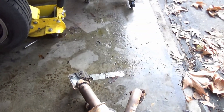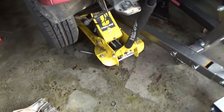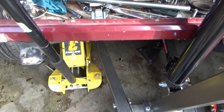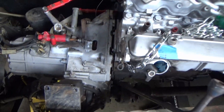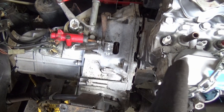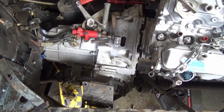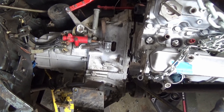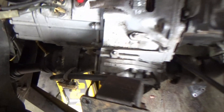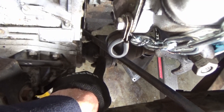At this point I was feeling kind of defeated — there was coolant all over the ground, the engine was no closer to being out, there were tools all over the shelf, and this thing was still there. The clutch and flywheel extend about four inches into the transmission, and that's four inches I'm just not getting on the other side to slide it out. So the new plan is to take the transmission out with the engine, and to do that I have to remove the axles.